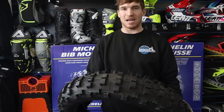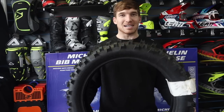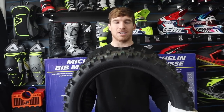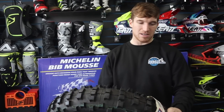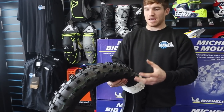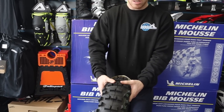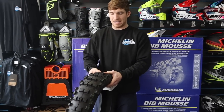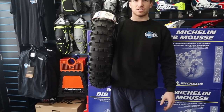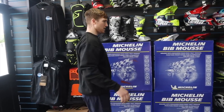They've developed it to be more like the Michelin, but these are still running so well. I know so many people still using this tire and they're really affordable — everyone's just jumping on their Michelin extremes when this is such a good tire and probably half the price. The only thing I find with a Mitas tire is that it flattens out — it squares off quite a bit instead of staying in shape — and they start to look ugly and feel heavy on the back of the bike. But other than that, mega tire. Mitas EFO7 Double Green, very good tire.